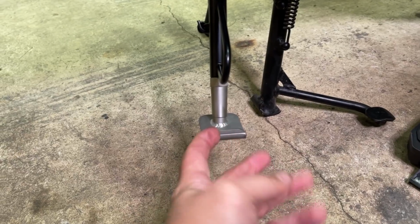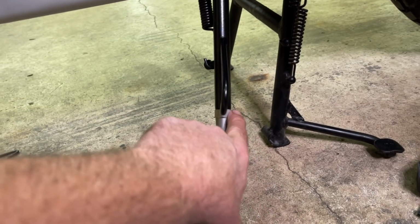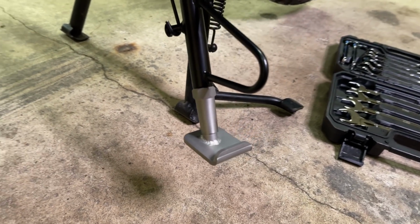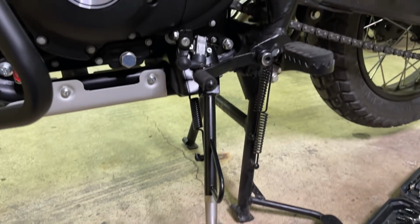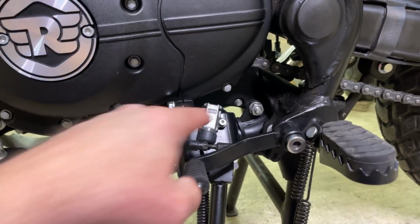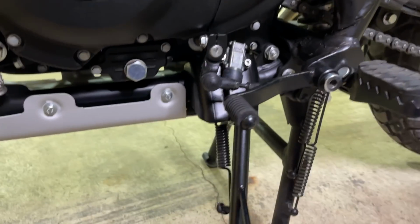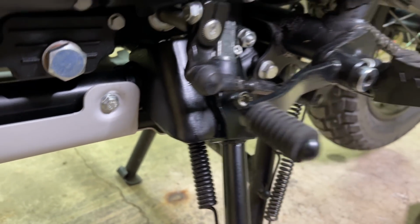And try to get it in a spot. And I'll just hold this with a pair of Knipex plier wrenches and tighten it, it's 19 millimeters, the nut. That's pretty nice. I don't care what you say. It's so pretty, I hate to scratch up the bottom of it. There she is. That's completely installed. Nothing else to do. I re-Loctited the switch bolts. All this is all tight. I just took the shift linkage and flipped everything backwards, as you seen it earlier, because it gets you access to everything inside there.